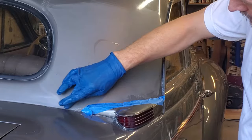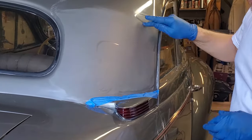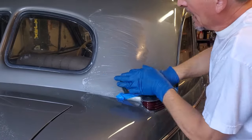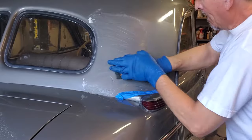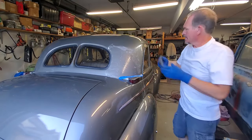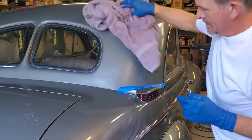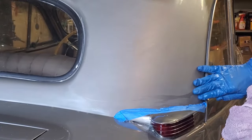What we're seeing now: there's still a little bit in some areas, and still quite a bit in the worst section — the area with the most nibs. I still need to go just a bit more on the top. This time I've switched to the softer foam pad because there's a lot of curve on this panel — that will help me cover it without making flat spots in areas I don't want. After a third pass, we'll do a little more work in the problem areas and then move on to the next step.